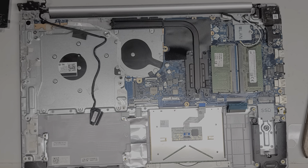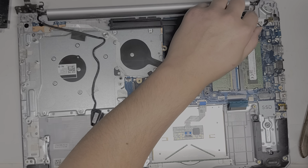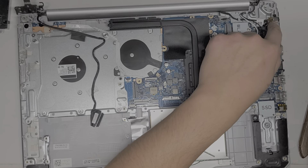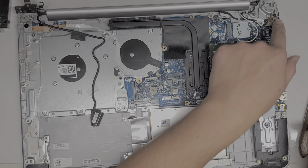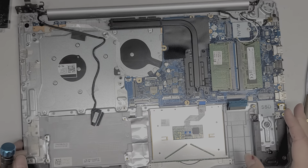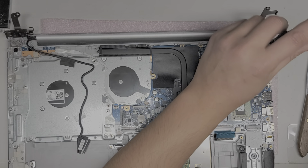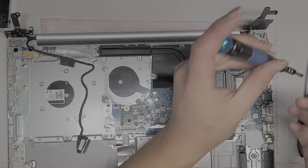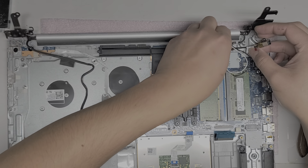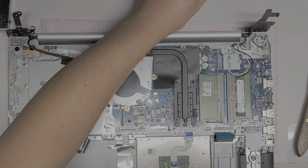I'm back. Now we should be able to lift this hinge up — there we go. There's the DC charge port jack here; if you want, you can remove that — there's one screw and then you can pull it up. Let me remove that as well. Remove this screw, then lift it up and guide it out. Just like that.